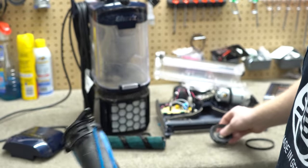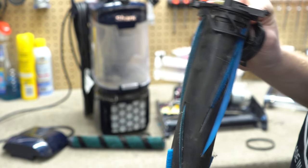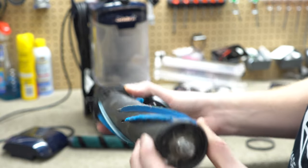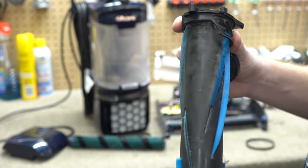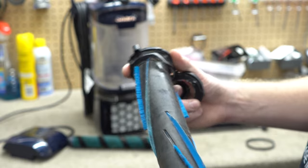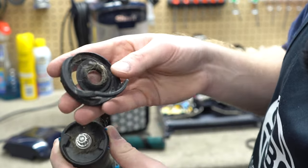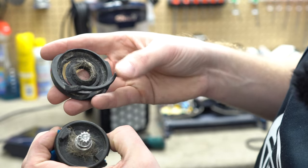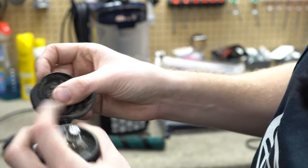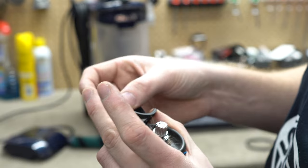This piece should at the very least be made of resin-filled plastic, but it's cheap ABS plastic. There could almost be an argument for this piece to be made out of aluminum with rubber mounts. But let's move on to this side — and oh no. I'm holding three pieces that should be one. This should be connected and molded together as one piece, and as you can see it has melted.